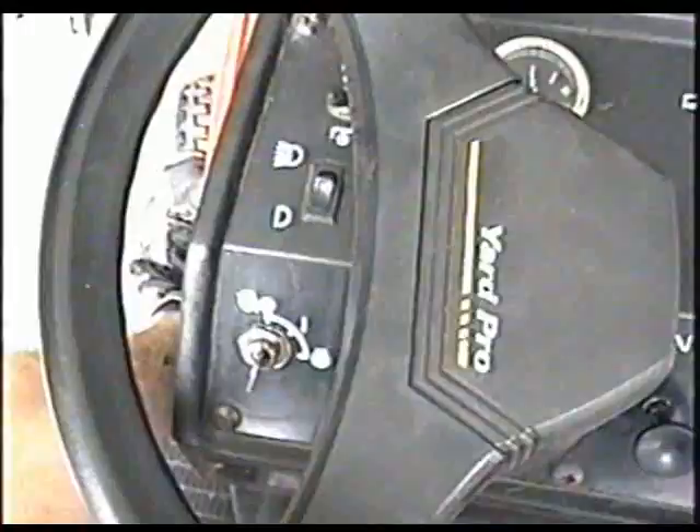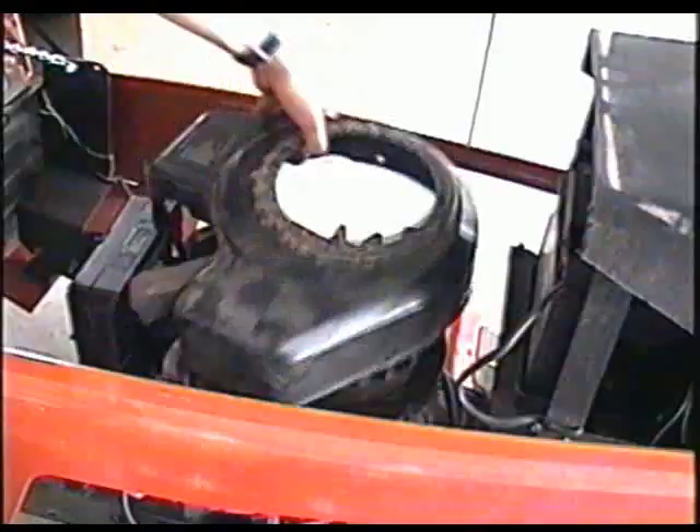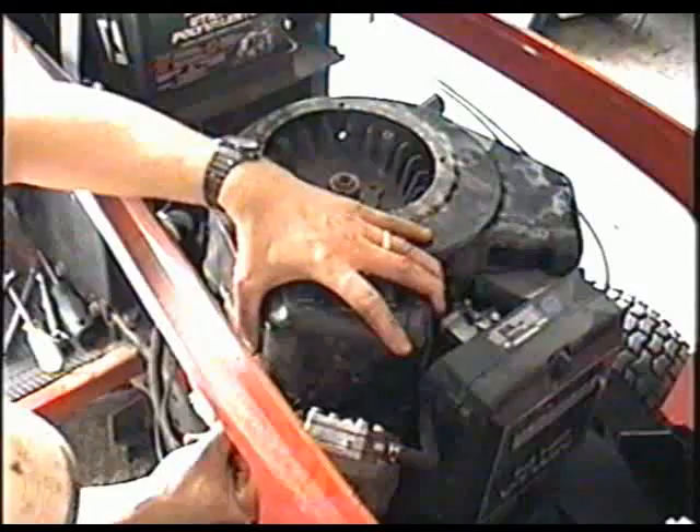So now it runs good and it turns off when it should. So I'm just going to reassemble the cowling and that job's done. Now just reinsert your cowling over here. If you have the part from the air filter, make sure it goes into there — I'm just going to stick it into the filter first. Then just clip this grommet back into the shroud here. That's the breather tube.